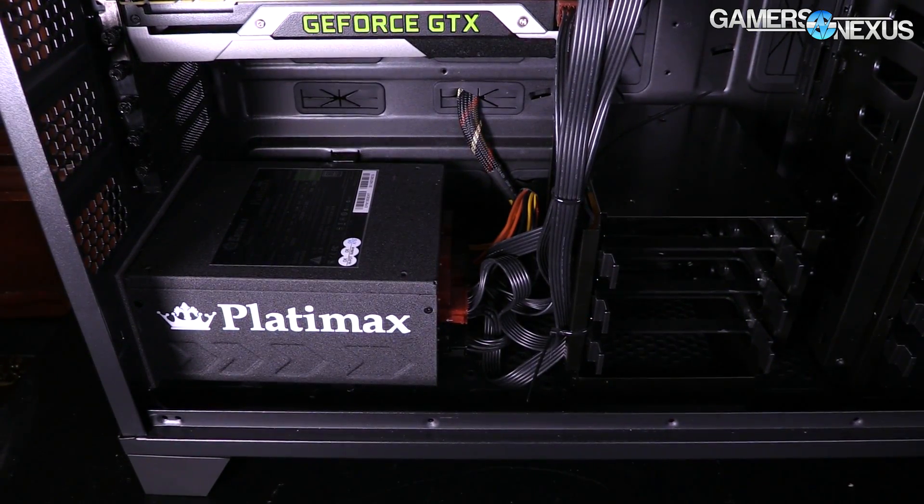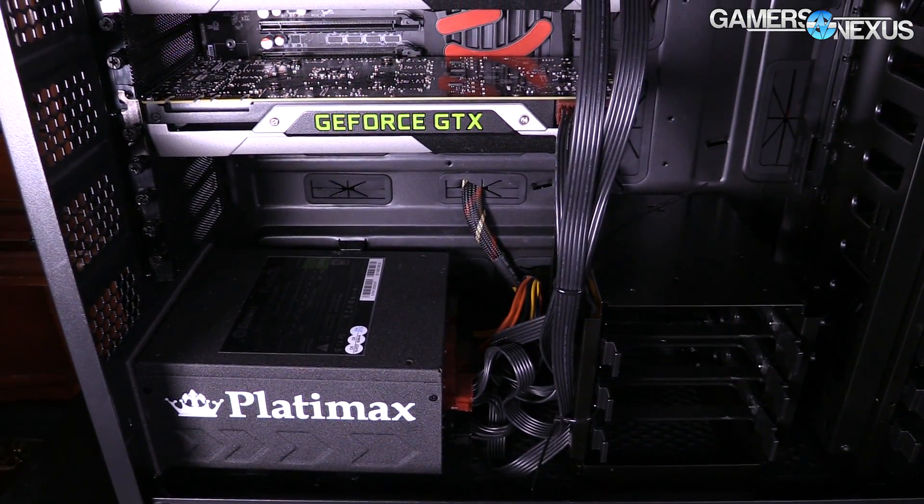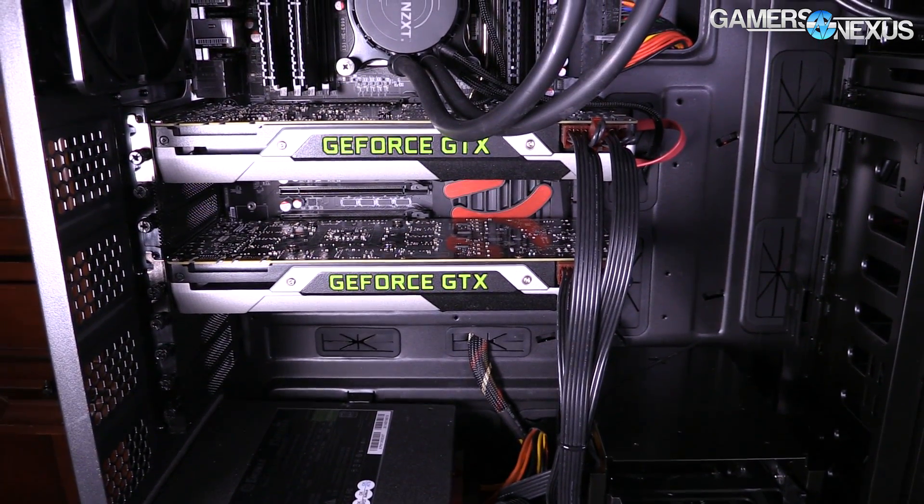It's just as easy as checking the manual. Always check the manual, because they'll have useful information about which screws are the standoff screws and other features that the case might have. On the motherboard side, the motherboard manual includes really important information — for example, PCIe slots for multi-GPU configurations. If you have a board like the X99 Classified EVGA board with maybe five PCIe slots, you can't just plug two video cards into any of those slots. It has to be correct per the motherboard's prescription to make sure they're getting the right number of lanes. Check the manual for whether you're supposed to use slot one and three, or one and five — it's very rarely one and two because they're too close and don't have the same lane count.